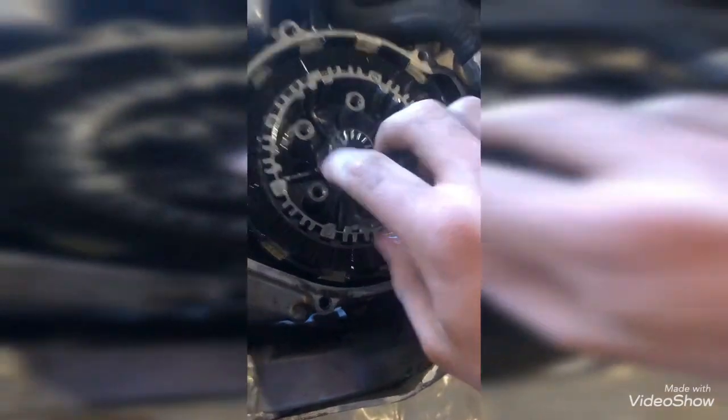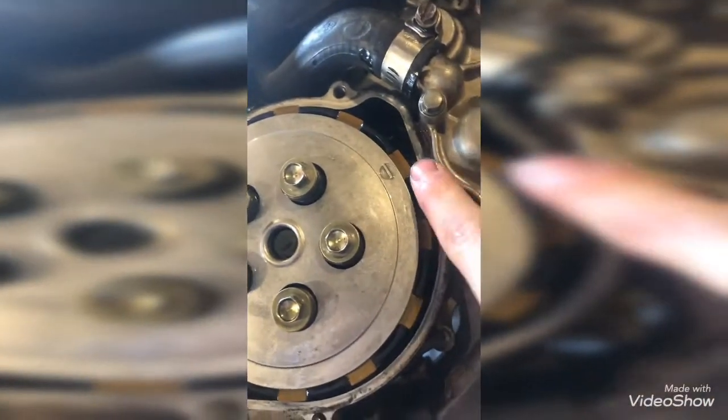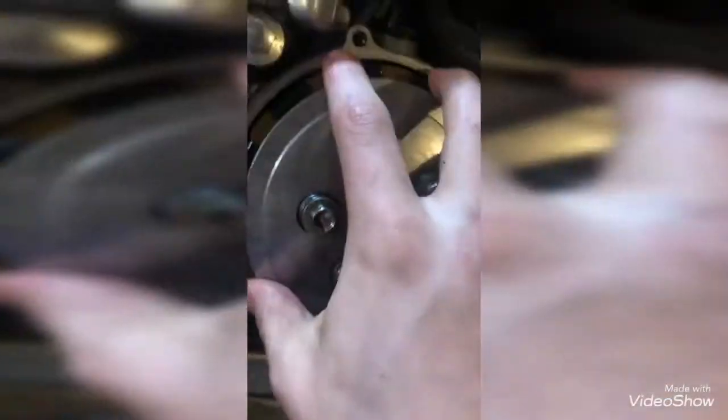Those pads are going. I will be right back when I pull these out. Alright, so I got all my clutch plates in — all the friction plates and drive plates — I got the pressure plate on, and I got the springs and bolts on right now. I'm not fully tightened yet. There is a specific order you want to follow with these. Make sure that you put them back in the order they came off. At least for my bike, a 2000 CR125, on the drive plates there is a flat end and a more tapered end. Make sure the tapered end is facing up.